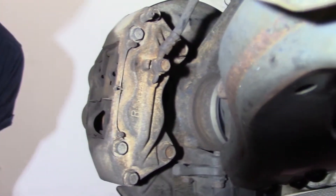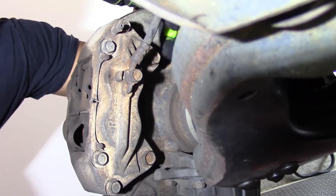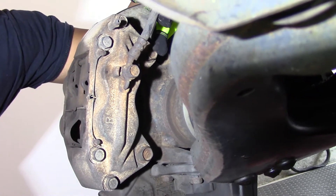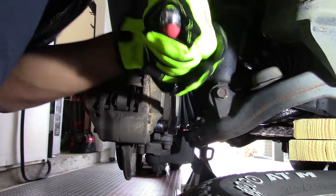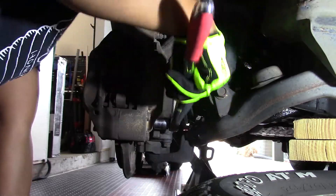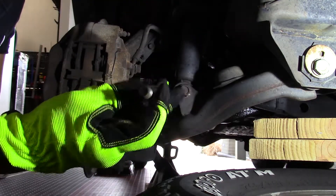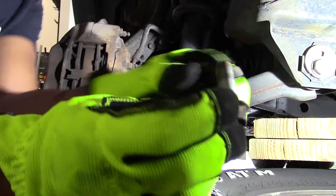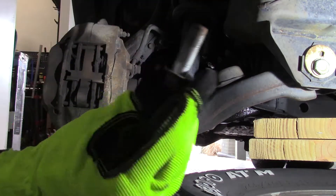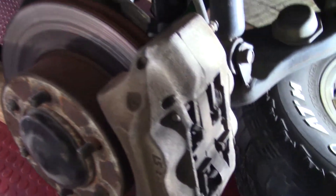This is an overall view panning around to show you the two mounting bolt locations. These are 17mm size bolts for your socket — pointing them both out here, that's the bottom and that's the top one. As mentioned, these mounting bolts should be torqued down to about 80 to 90 foot-pounds, so it'll take a little strength to get these off. Use a long extended breaker bar or socket wrench to get these off.